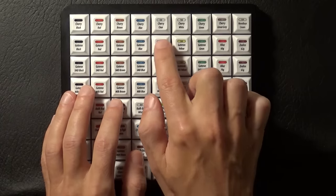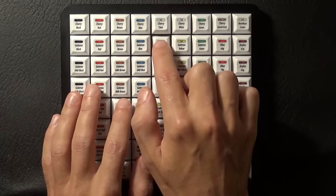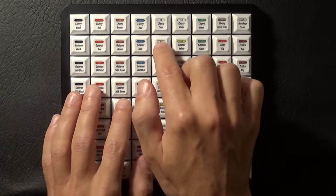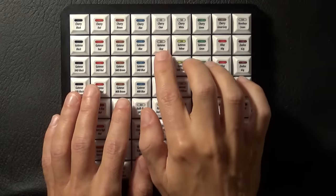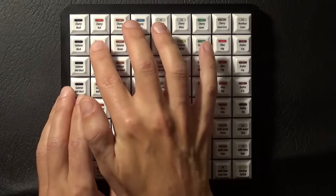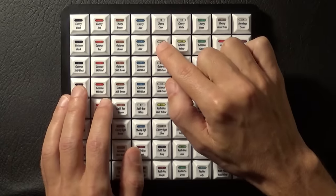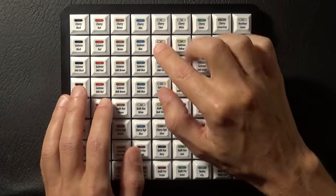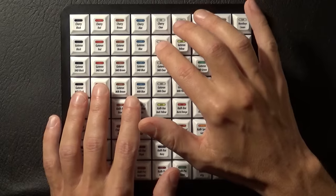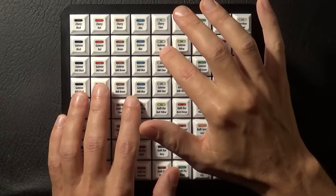Here's the Gateron Clear. It's an extremely light switch. It's linear, no resistance, no nothing you need to get through before you can hit the floor of the keyboard. It's only 35 grams, 10 grams less than the red one. Very light, linear, perfect for gaming, and I guess that's the reason they have started to produce it. Gaming, they have a very quick response, very quick activation.